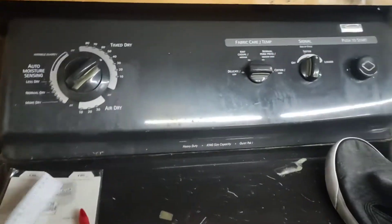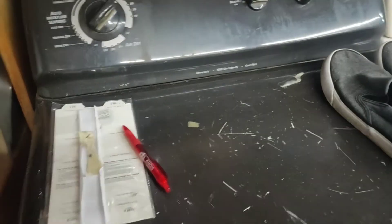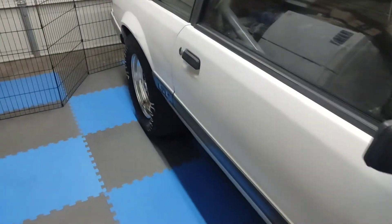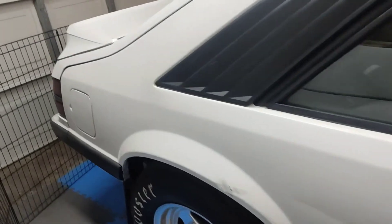We made some suspension adjustments as far as ride height — I brought the ride height back up a little bit. We got the plumb bobs out, measured our anti-squat and what have you, right here with the ruler. I've kind of plotted the rear end and plugged it into the baseline outlaw instant center calculator. We've got a fair amount of anti-squat.